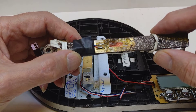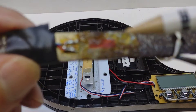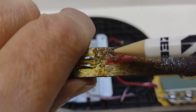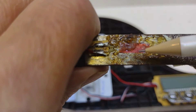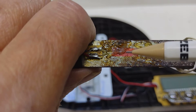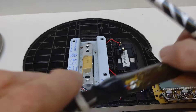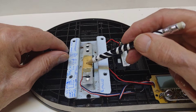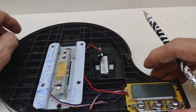If we look at the strain gauge on this, there's only actually one. The thing itself is very cruddy because it's very old, but hopefully we can see the strain gauge — that's this red part here. It's actually just a very thin piece of plastic with metal on it. As the thing is bent, these pieces of metal get longer or shorter, changing their resistance. This change in resistance is what is being measured by bending this rod. I'm very interested to see what happens and may use this for my own experiments.